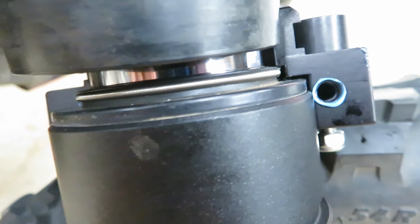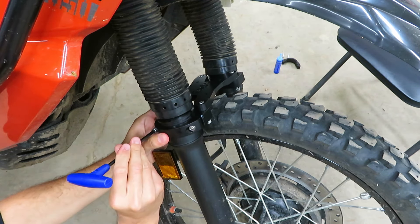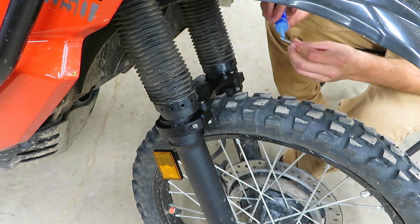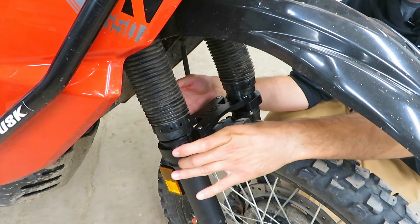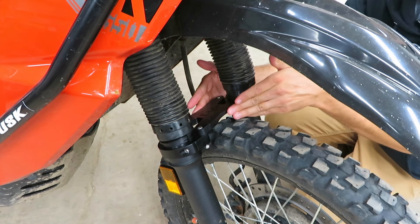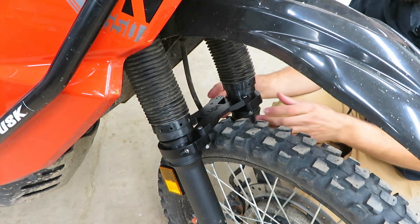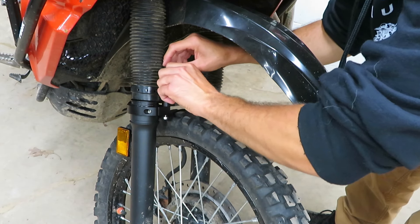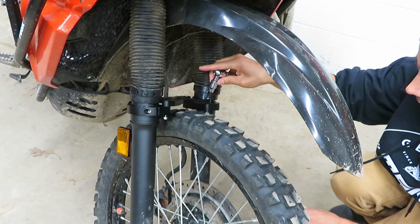This is how it interfaces with the top of the fork tube — there's a little section view there — and I'm going to stick a little bit of blue Loctite on these fasteners. I'm not actually tightening anything down yet, just getting everything loosely fit into position. Same deal on the other side. The instructions say to make sure this is lined up with your tire — I'd assume the flat parts on each side of the tube clamps need to be parallel to the tire — and make sure it's evenly placed in the center. Gently snug everything in place, starting with the sides, not going crazy tight, just snugging the fastener heads down so there isn't a bunch of slop between the parts.